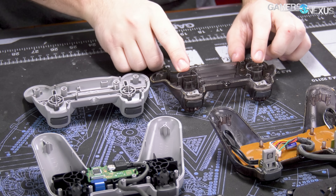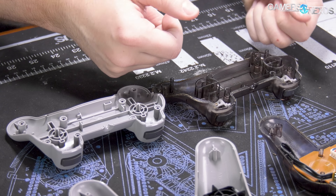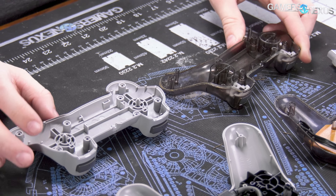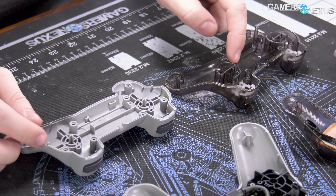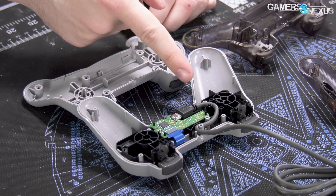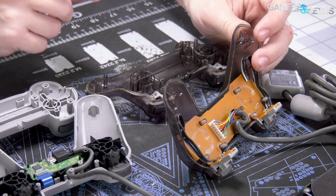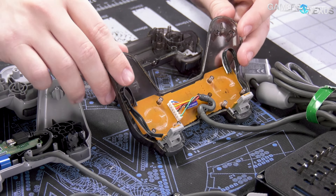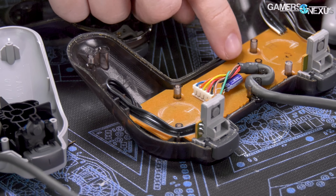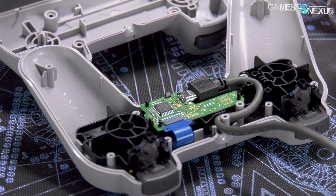For the most immediate differences, you can see that the base of the original controller has these plastic supports underneath the button panel and the D-pad, where pushing down on those things gives some rigidity beneath them — there's no electromechanical function other than support. On the new one, instead of having these supports on the base, they've moved them to the top of the controller and attached them to the underside of the PCB mount. And the PCB size difference is tremendous — they've got pieces of PCB in here for the bumpers. It's amazing how much technology has shrunk.